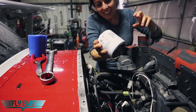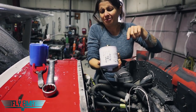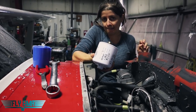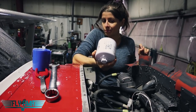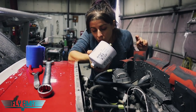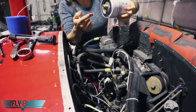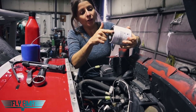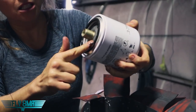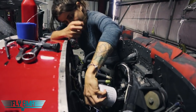Did you pre-fill it? You might want to put a little bit of oil in there first — on the edge, and try to get some in the filter itself. If you don't, the engine is not going to be getting oil when you first run it, so try to put some in there. Pre-fill it the best you can without spilling too much. Apply a thin bit of oil — new or used — around the O-ring on the new oil filter. Spin it on and follow the directions on the filter: typically make it hand tight, then go one to one and a half turns past that, or whatever the spec may be. Then re-safety wire it in place.